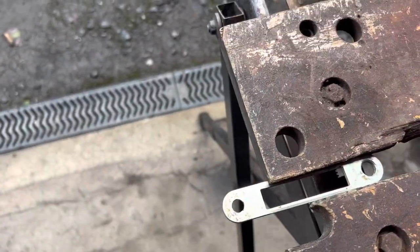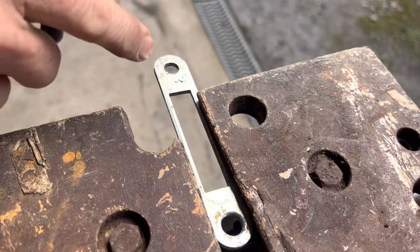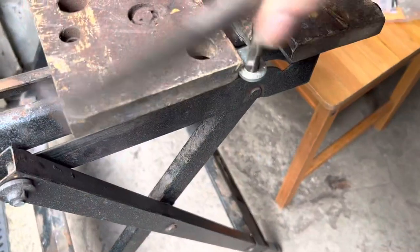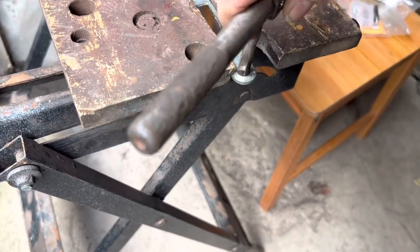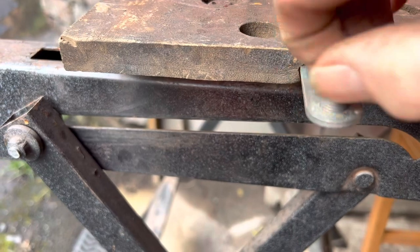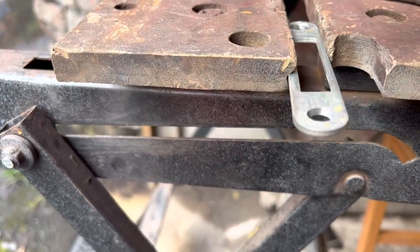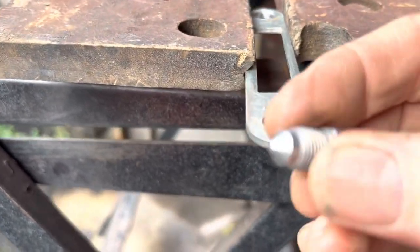The left-hand spiral drill set goes up to 8.7mm. We're going to drill a test hole first and then tap it to make sure we have the right size. Looking at the 8.7mm hole, ideally a 9mm hole would allow us to use this tap. In this test case we used the tapered tap and confirmed the threads are correct, so it now just remains to be seen if we can drill the snapped bolt out of the caliper without damaging it.